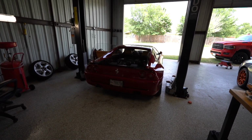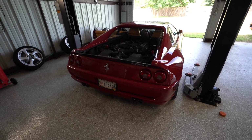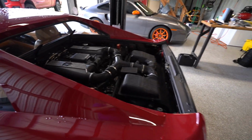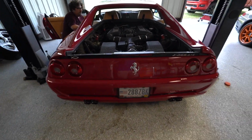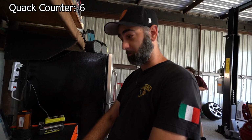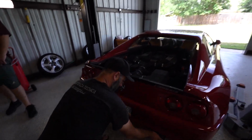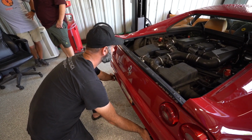Whoa. What was that? That's the starter. All right, let's see what comes back. No check engine lights yet? Nope. Well, it just hasn't run long enough. Yeah, you can hear it's not running super great. God, those secondary airs are loud. This thing sounds bad. Yeah, injection timing's super high. You see it's not even refreshing at a good rate. There goes the secondary air, thank God.